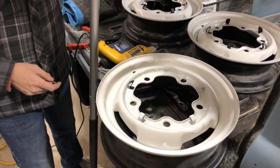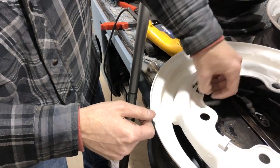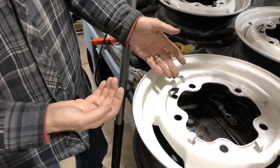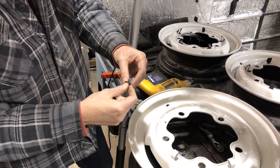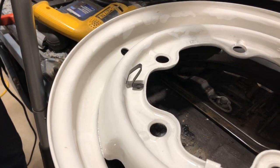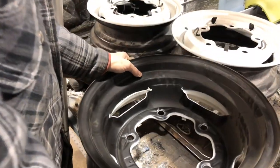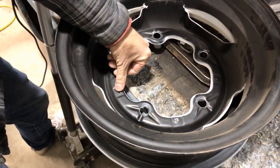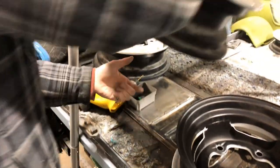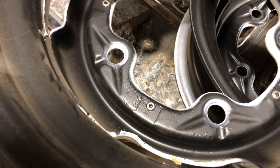Some people might not like our technique. The original rivets that Volkswagen used were the pounding style — you put it through and then on the other side smash it flat. I found that extremely hard and awkward; you could see getting this in was a pain in the butt. So we decided to go out and buy some stainless steel rivets. The concern is you need a flat mounting surface at the back. You do have a little bit of a divot from Volkswagen in the rim itself, and if I flip over the completed one, you can see these are pretty flush.